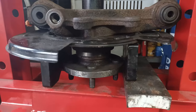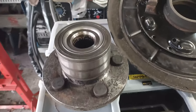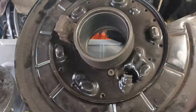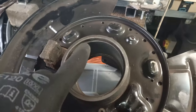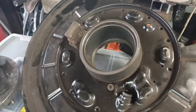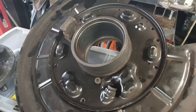Here's the stub axle and hub bearing, and here is the bore on the knuckle where the bearing should fit. This ring going all the way around is where the circlip should go to retain the bearing. However, there's no sign of it - it looks like it's been damaged or lost. It should really have stayed in there but for some reason it's come out.